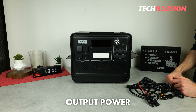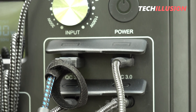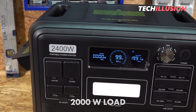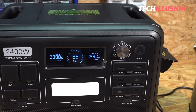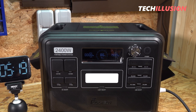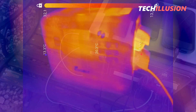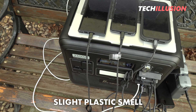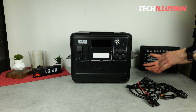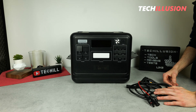Next, I tested the output power with various devices. 2400 watts is definitely a substantial amount, but whether the power station can actually maintain this consistently is another matter. I loaded the fully charged device with a constant 2000 watts. After 15 minutes there were no issues, and after almost 30 minutes the power station had already lost 50% of its battery charge yet still seemed extremely unimpressed — the fans were not running at full speed and there were no performance drops. The only thing I noticed is a slight plastic smell at the beginning when the power station really gets going. Compared to other power stations already tested on this channel, the FossiBot ranks very high in terms of constant performance.